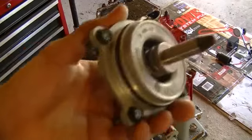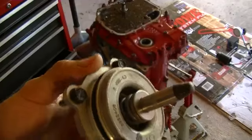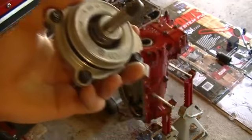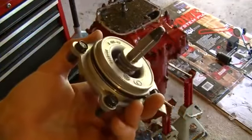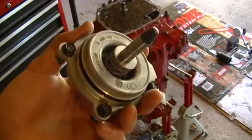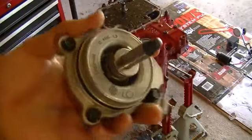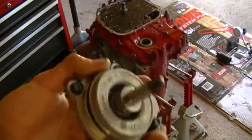In this particular transmission, this is also an accumulator. Accumulators in transmissions work like when you're driving a standard transmission and you need to engage the clutch smoothly for a smooth shift. You'll let it go smoothly onto the clutch. You won't make it harsh. So this is pretty much the foot in an automatic transmission. If the fluid fills up the clutch packs too quickly, it'll engage them very quickly and very hard. But this will sort of have a reservoir or a cushion for the fluid to not be applied so harshly, and then you will have a smooth shift.